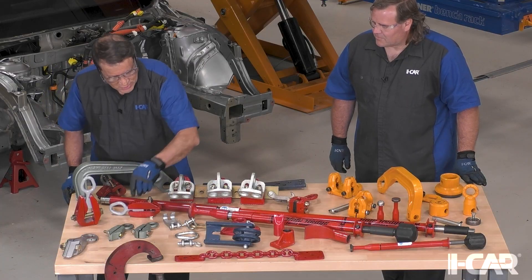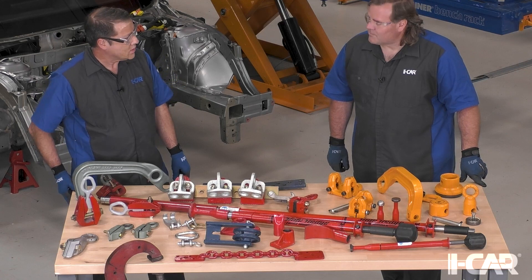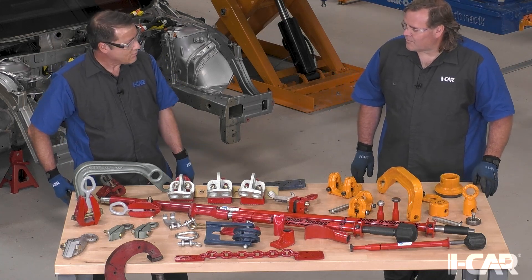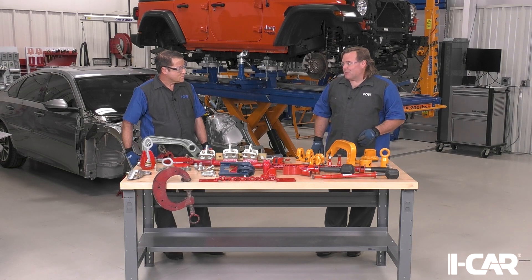Throughout pulling all these vehicles we had our hands full — there were times we had to get creative. You can never have enough pulling bars, and many folks have different pieces of steel they've used, drilled, or professionally created ones available for purchase. The ones with chains on the end and pulling plates come in very handy for adapting into different places. Different rigging attachments — whether it's clevises, d-rings, and things like that — you can never have enough. We were always looking for something with a little more space, and we even had the machine shop make some.